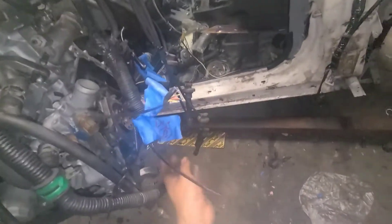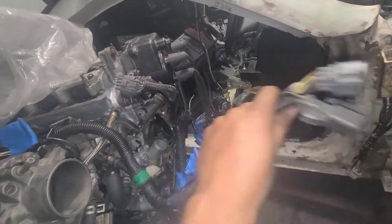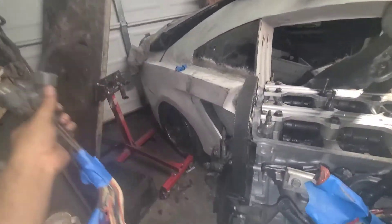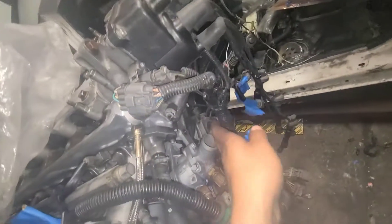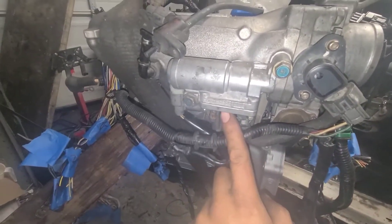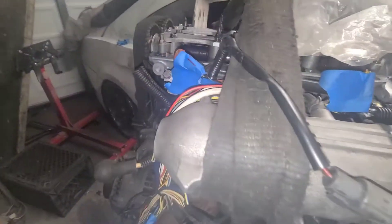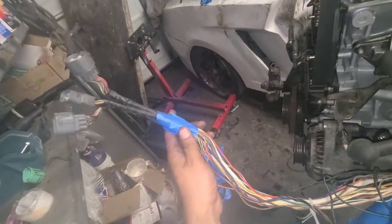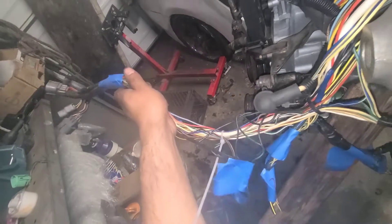What used to be the driver's plug is now the passenger's, went this way and vice versa. The wires didn't get cut but I'm labeling each one of them. The distributor has to be extended. Back here there's water control, idle control, MAP, and purge — those didn't get cut because they're in the harness this way. Most of these groupings didn't get cut, just elongated, so I'm just gonna tuck them. Here are the injector grounds — those had to be cut and extended 12 inches.